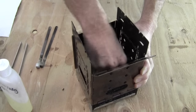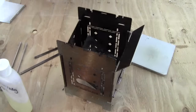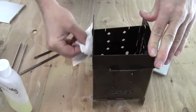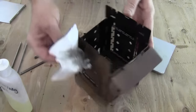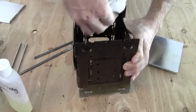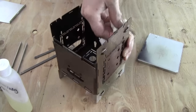I've done all the sides and now I'm just doing the bottom fire grate. I'll even put some on the ash pan. I'm going to kick up that fire grate and do the bottom side of it. Then you go back through with a second paper towel and just wipe everything down. This takes off the excess oil. A little bit of oil does make it into the hinges and just keeps it operating really nicely and smoothly. I don't worry as much about getting all of the oil off the inside of the firebox as I do on the outside, because it all just closes in and you don't have to handle it on the inside, but it is good to get that coating of oil on the material.